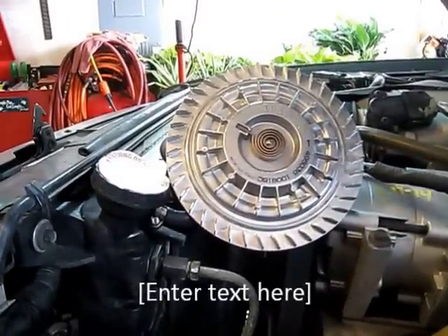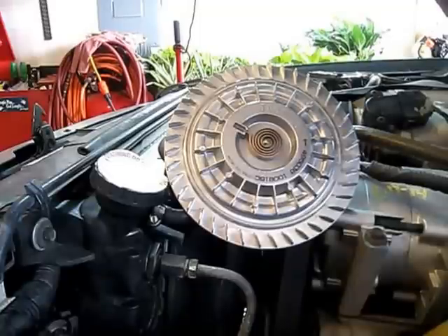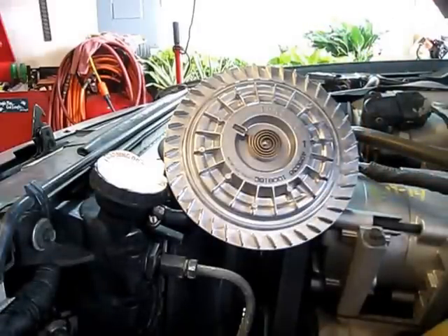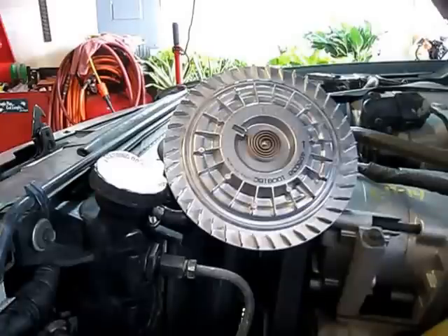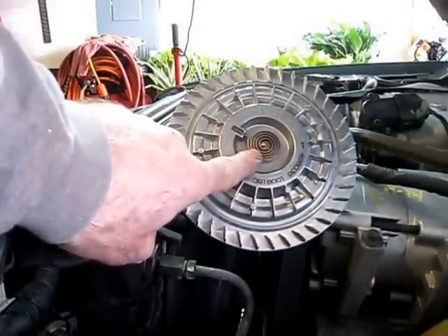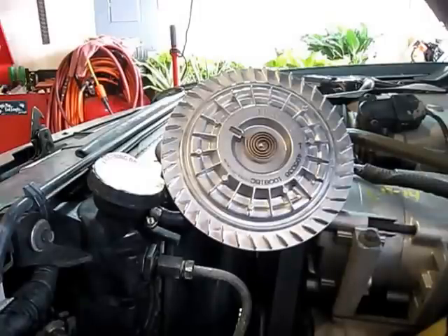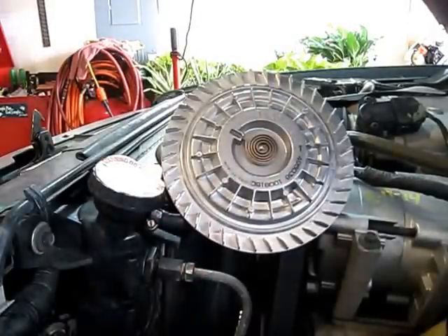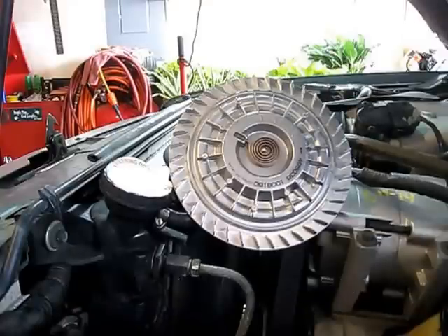Today I've got a clutch fan on a 96 Mazda, which is really kind of a Ford in disguise — we call them Ford Rangers. I'm having a problem with this rascal right here. This is the new one, and I'm going to show you this first. What I looked up on YouTube, all you heard about was engine overheating — that's one of the number one things that happen when the clutch fan goes out. This little coil gives up the ghost and doesn't want to tighten up and make the fan spin, so the engine overheats. That's not my problem. When this stays tight, it wants to spin all the time, so mine sounds like a jet engine going down the road. Does it hurt the engine? No. Does it hurt fuel mileage? Yes.